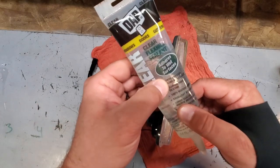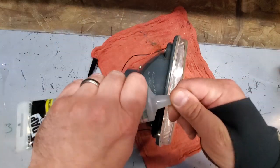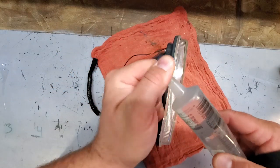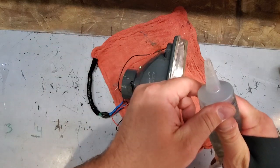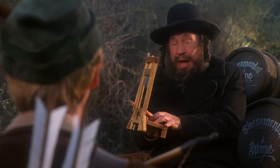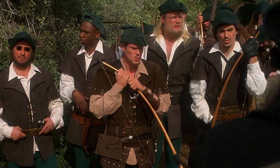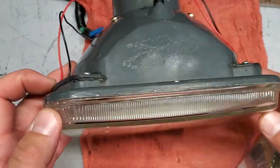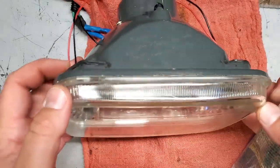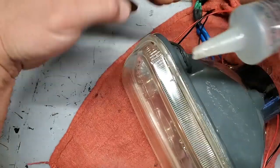I found this flexible silicone sealant — it's clear and flexible, rated for gutters, windows, and doors — it should work perfect for the lights. I'm gonna open this up and apply it. I need to nip the tip. It's just a tiny little crack between the glass and the body of this light, so I'm gonna go ahead and seal it. There's a top to this light, so I'm just gonna work right along the edge of the top.